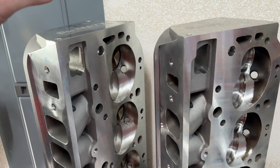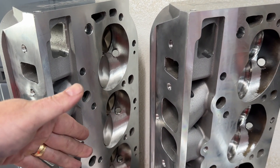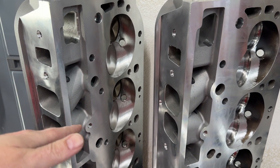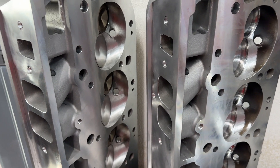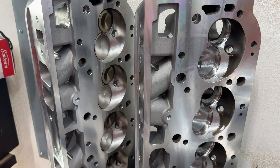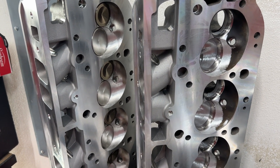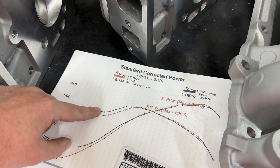Here's what's been done. On the 317s, I flat milled them down to 110cc — that's about 54 thousandths that got removed — so that gives you a 110cc chamber now for these. These two heads should now have the same compression ratio when we test again. So we're going to find out if the 317s will pump this back up or make even more and then keep going.